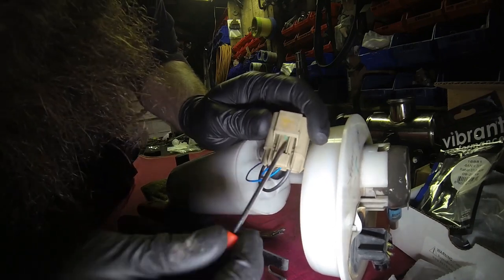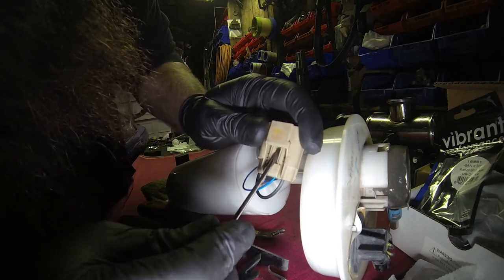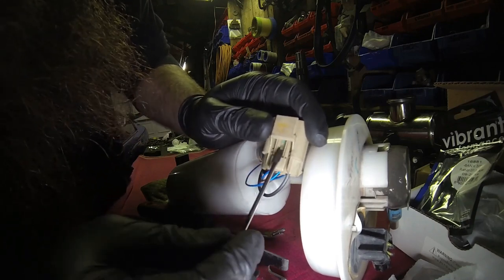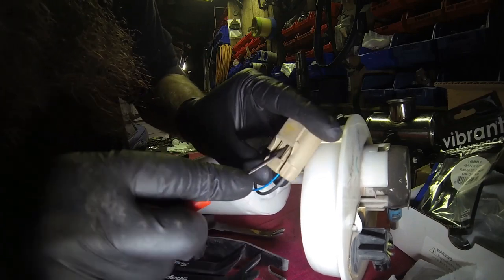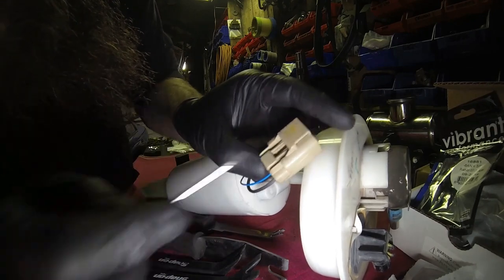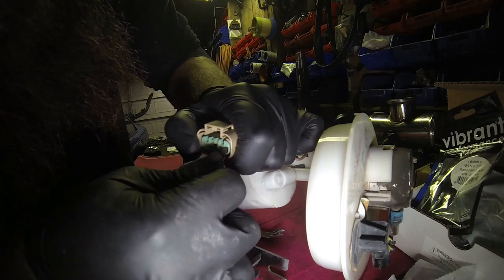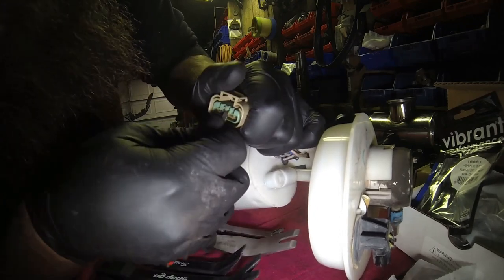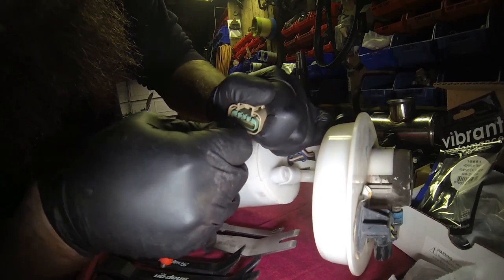Hopefully you can, but what I like to do is, if you don't want to put it in here sideways, because you'll damage and break the lock, as well as just possibly slip it underneath of the connector. So go flat at it on a 90 degree, push it up, get it on the side, kind of push it up a little bit if you can, and then you get it all the way up to the top here. Put your screwdriver under it, pull it out, be cool with it, don't want to get too rowdy and break it.